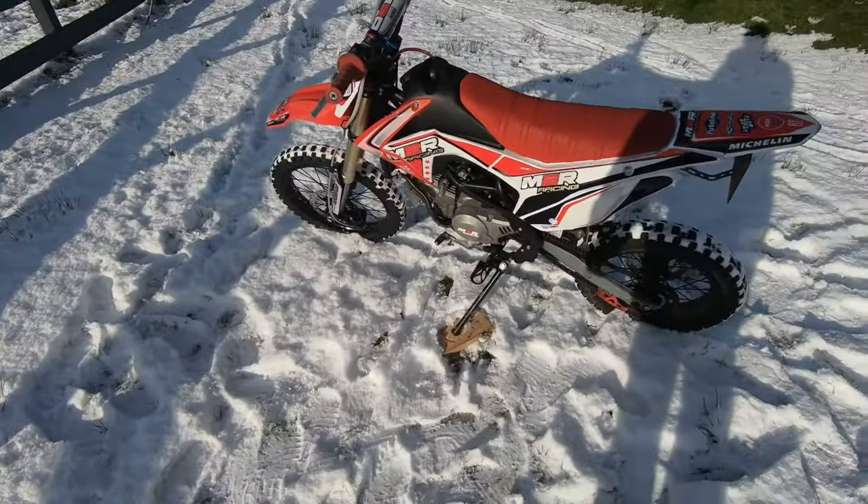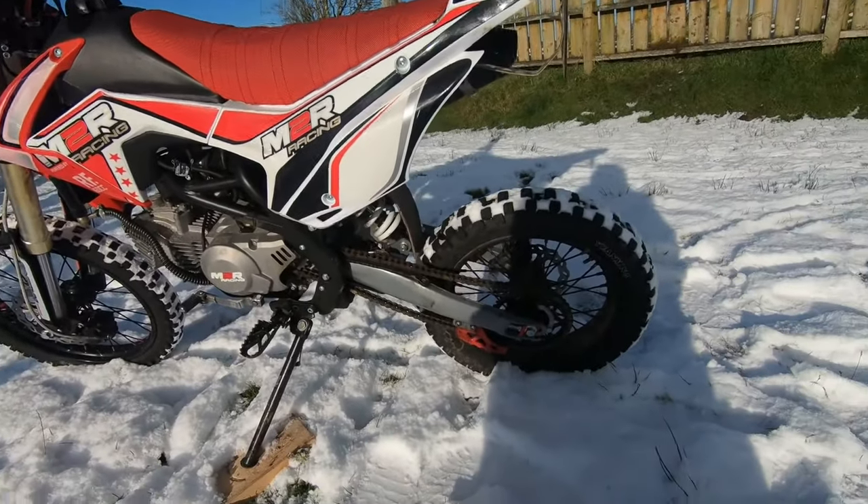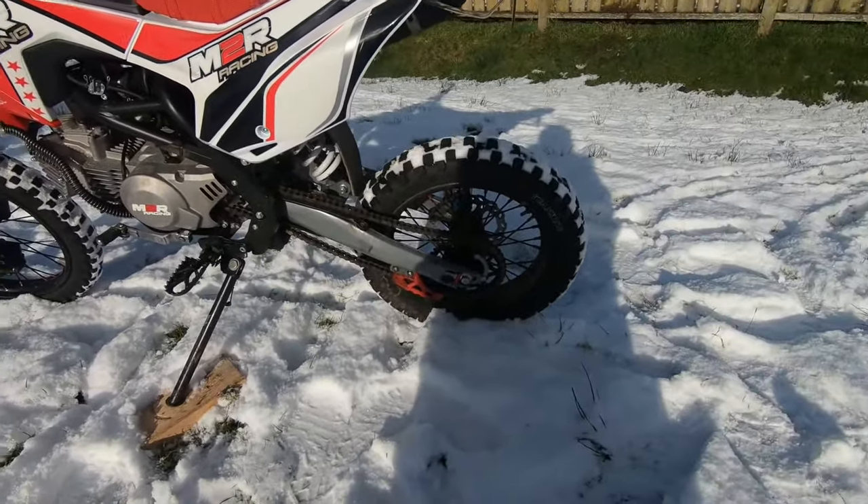So the main ones are horn, speedo, and make sure the bike's in good enough shape - that's pretty much it. The tires, I'd say, depend more on your MOT tester, so that's up to them. If you can get e-marked ones then all the better, but there should be no real need.